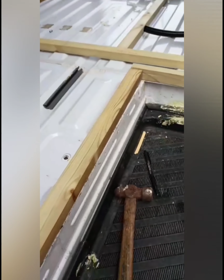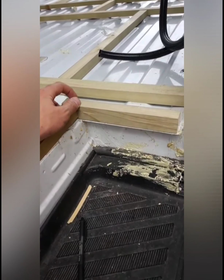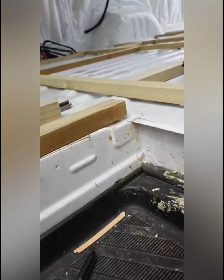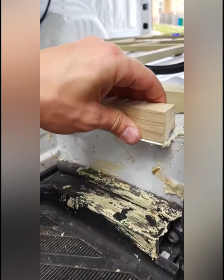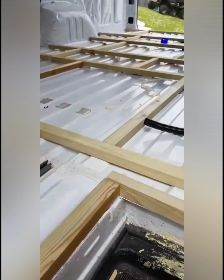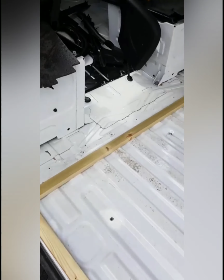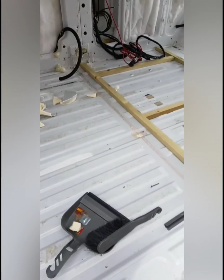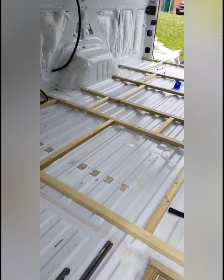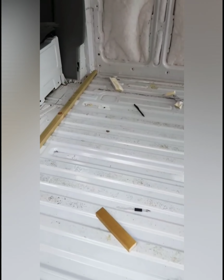Before lunchtime, what I've done here is I've built the frame round the door. Here's the 25mm that I've had to actually shorten, because you'll see that it's not actually up on the tip. So I've shortened that, cut a lip out the end, and that fits in. And I might just have to sand down that little edge here. From there I'm going to put 2 more beams down the side, and then that's where it's going to end. And then once this is in, I need to mark down where the frame's down, and then start gluing it down. But before the glue, I need to start cutting out the Celotex in each place, which hopefully I've got enough for. I think I might have even got extra.